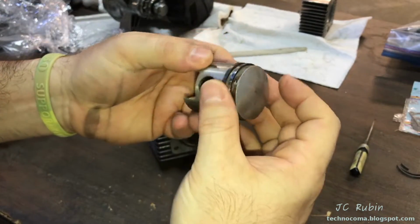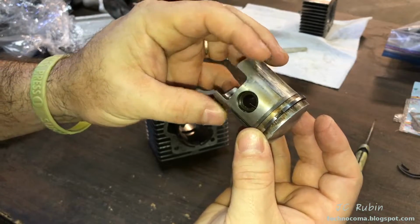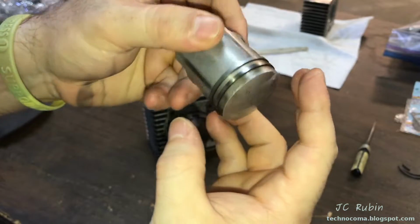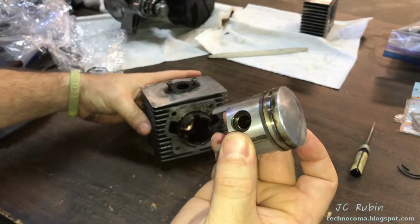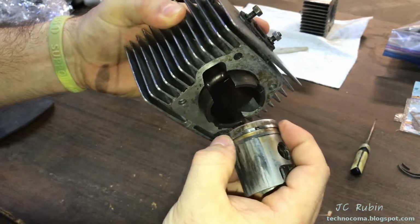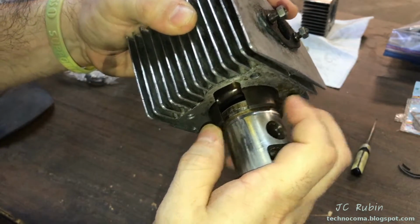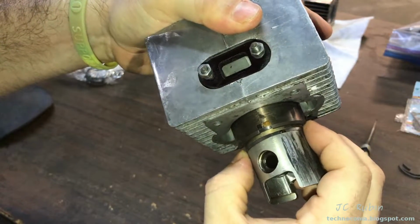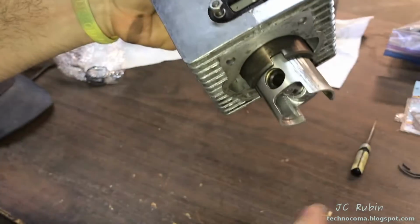There are detents here which set the location. Let's see, there's one right there, detent right there, and detent right here. Gets them into position. Should be able to do this by hand, one at a time. Yep, there's the first one. I just want to get one in at a time, right, and then reevaluate the detent again. So now I'll get this detent in a position, right, and there's the second one.